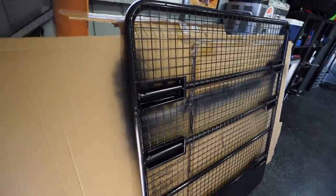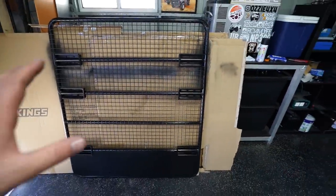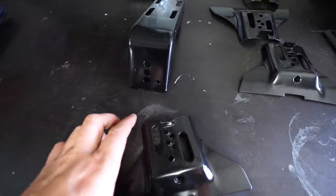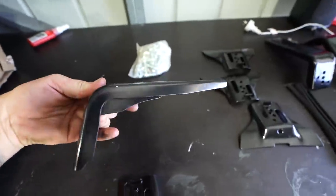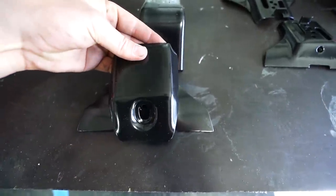The roof rack is done. I just bogged up a couple of the grinding marks and laid some black paint over it, and she is looking really good. I'm honestly quite happy with how that turned out - you can hardly tell it has even been shortened. I'm pretty certain you can actually just go online and buy a flat rack for a dual cab that's very similar to this, but I didn't have time to order one online. Now I need to figure out where our mounting locations are. These are basically what you get on a gutter mount kit - you have the bracket that connects to the roof rack, the piece that connects to that bracket and sits in your gutter, and then a clamp that comes over the top and sandwiches on your gutter. I'm going to pull the Triton in, measure how far away these brackets need to be, pre-fit them to the rack, and then hopefully lift the rack up and get it installed.